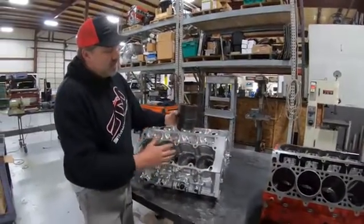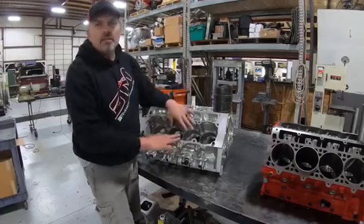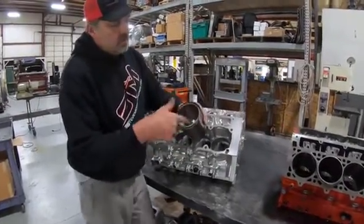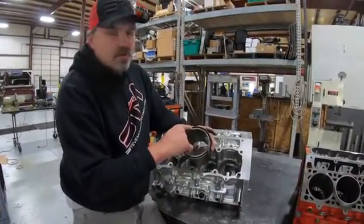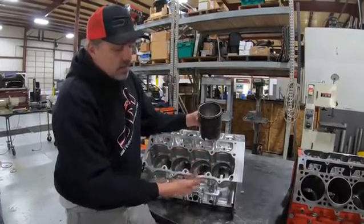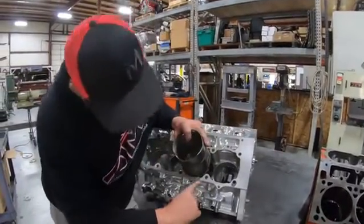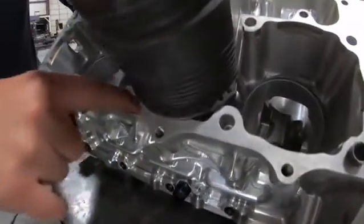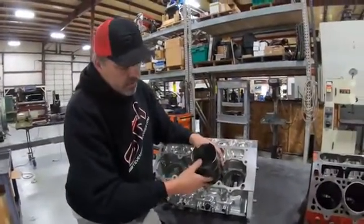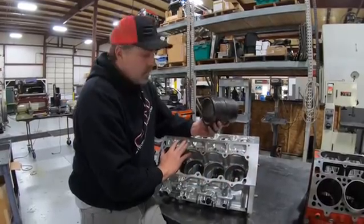I'm not a big fan of this design. If it's making 1,500 to 1,700 horsepower it's probably not a big deal — it's a nice wet-jacketed block. But for my replacement sleeves I've made them solid — no water coming up through the deck surface at all. I'm going to dry deck this, block off those passages, and find a better way to make this a more solid deck without water in between the head gasket area, so if it ever does blow a head gasket, it won't spray water everywhere.